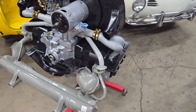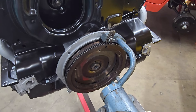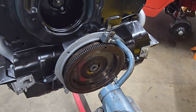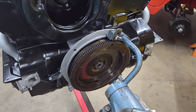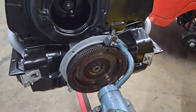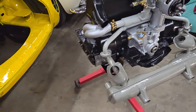Pretty good progress on this today overall. The flywheel didn't get machined — I'm going to go ahead and pull it off and send it out to a machine shop we use to have them resurface it. It actually looks pretty nice, which is why our long block builder didn't do it, but at this point it just makes sense to machine that surface. We're putting in a new clutch disc and obviously a new pressure plate, so let's just make everything new and do it right.